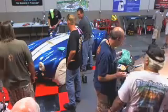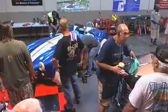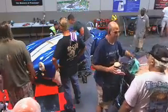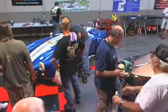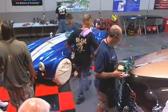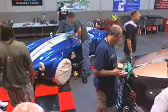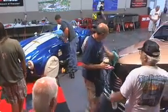Even on sharp edges, no problem? Well, it's never a good idea to buff on a sharp edge no matter what, because the paint's thinner there. But if you hit it, it isn't going to kill it. Just don't stay on top of it. Don't hammer on it. Keep rolling. With a brand new Toyota, Honda or Ford and a light polish, they've got so many body lines it's almost impossible not to buff on one, but that's brand new paint and it's really hard, so it's not going to be a problem.